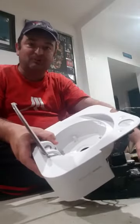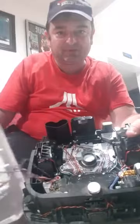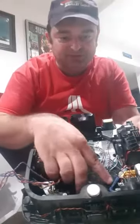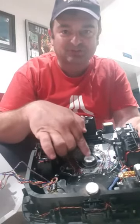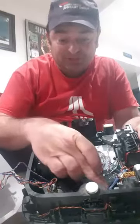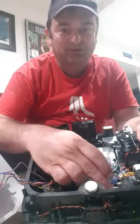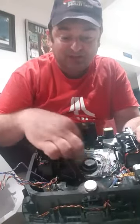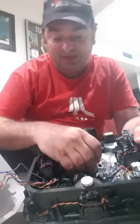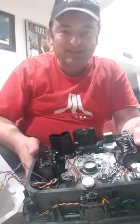If your stuff is still not working, what you can look at is there's one more hose down here. It runs from the pump to where it actually gets its water — the sucking action of the water. I'm not going to remove this; it's a little bit more complicated. You can probably wiggle it out the same way, or it'll be easier to just blow it out with your mouth or some kind of compressed air. There are also a lot of wires laid very neatly in here and I really don't want to mess that up.